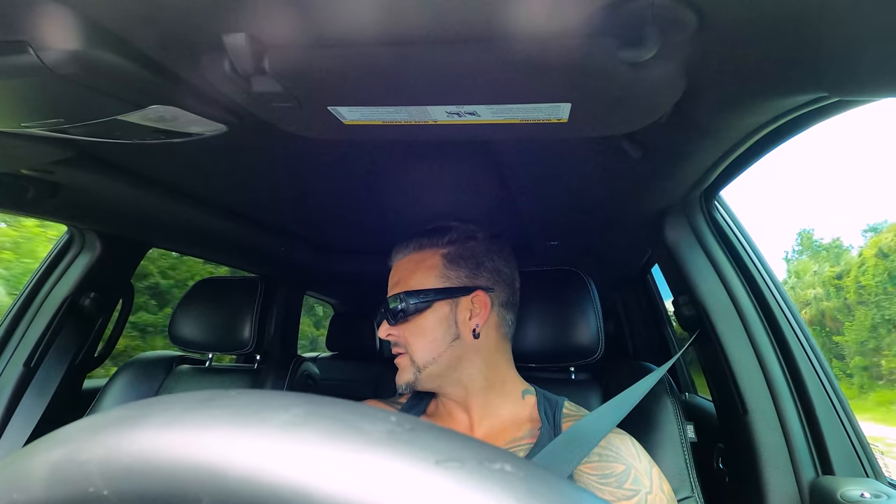We're now at 131 degrees, so it's probably safe to say we are not going to see intake air temperatures under 130 on a stock Trackhawk on a day like today. That's going to be our lowest baseline because we were above that just sitting there idling.